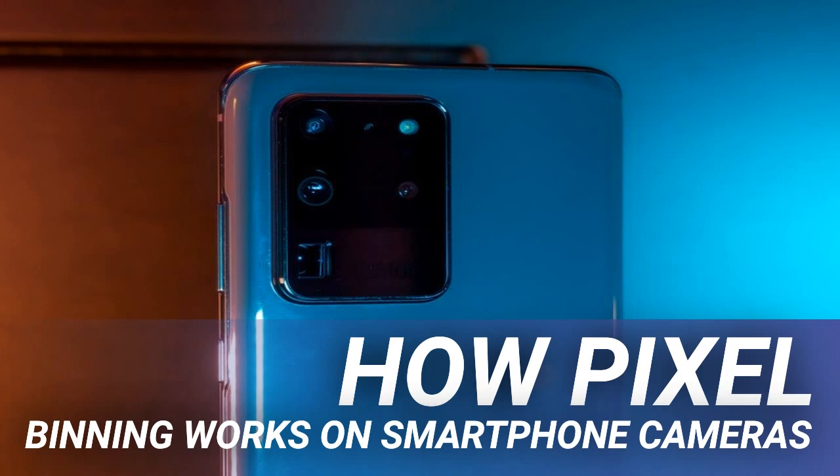There's a lot that goes into this, and that's why it's better to look at it from a slightly non-technical perspective. Let's take the Samsung Galaxy S20 Ultra as an example. It has a 108-megapixel image sensor, though it only works with the standard lens and regular photo mode. With a 9-to-1 ratio, binning can knock that down to a 12-megapixel image, which means each pixel is considerably bigger and therefore better able to capture more light.